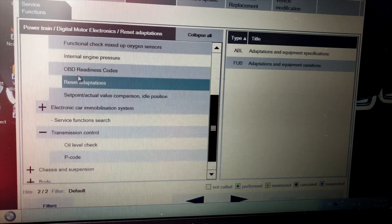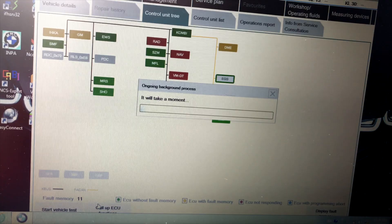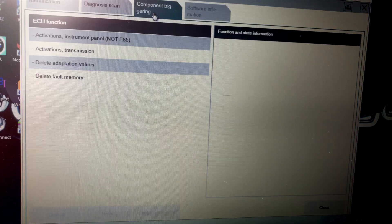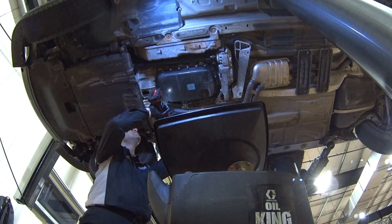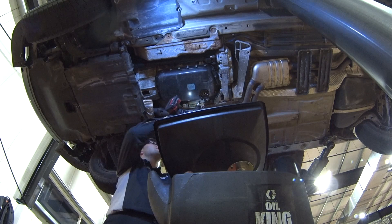Be aware that if you don't reset the VTG values, it may cause internal damage to the transfer case. It's up to you to do your homework on your BMW and choose your course of action. Stay tuned for the next video as we have the opportunity to service the automatic transmission fluid due to the vehicle's low miles.